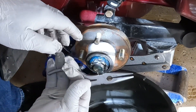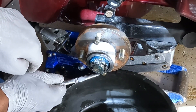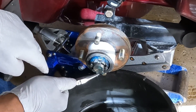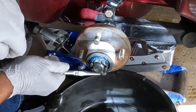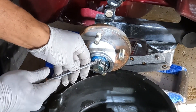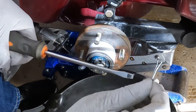It actually works better with needle nose pliers, so I'm going to take the needle nose pliers and I want to straighten out that cotter pin so I can pull it straight out of the axle. I'm going to get it as straight as possible. Now I want to pull that cotter pin straight up - I'm going to take my flat screwdriver, kind of stick it in between the cotter pin, take my hammer and just hammer it up. There's the cotter pin.